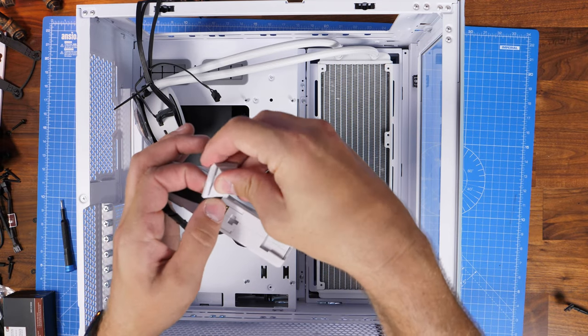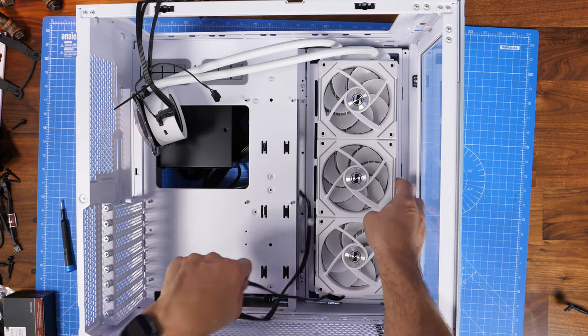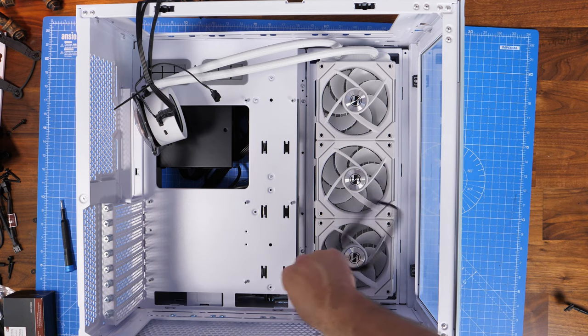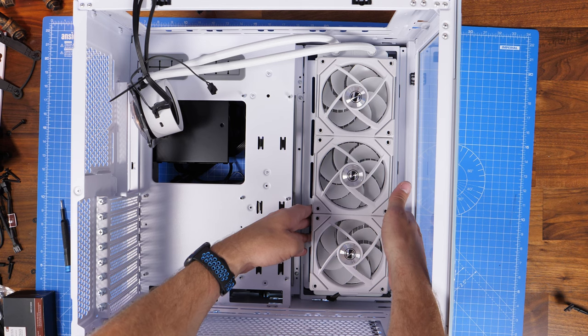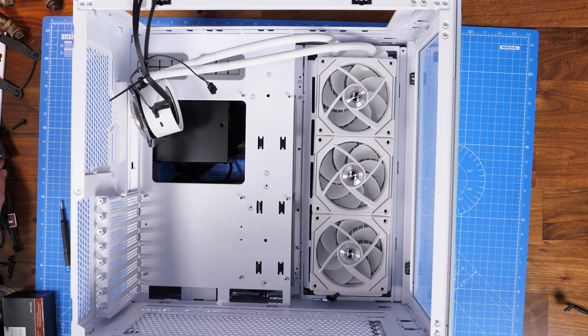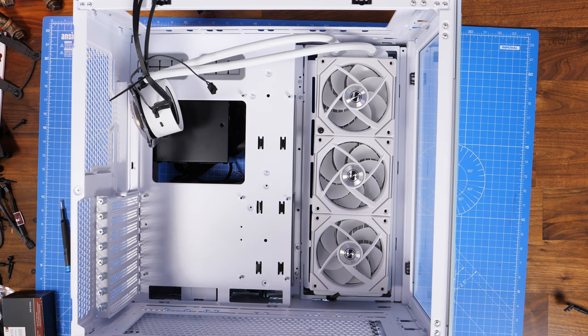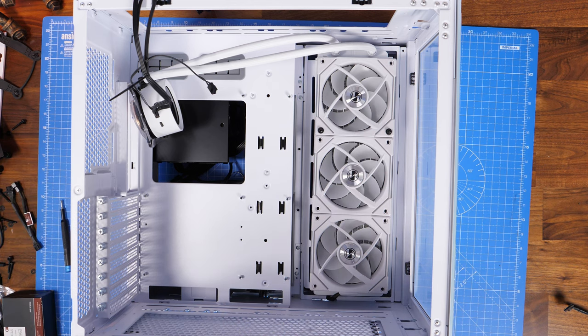I'm also adjusting those cables. The cables on that fan are really good because you can flip the cables round, change the direction of them, and then run them to the rear. I have done more in-depth videos on how to wire these fans and how to set them up in your case in multiple ways — be sure to check out the links in the description. But basically now mounting those to the radiator with long radiator screws — and that's that lot sorted. The radiator is ready to go and we can then worry about the rest of the fans.